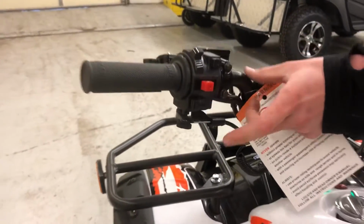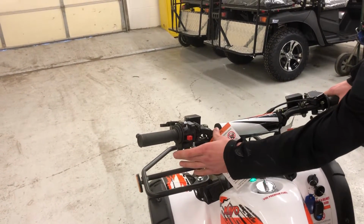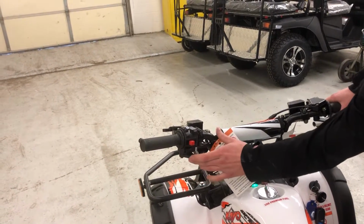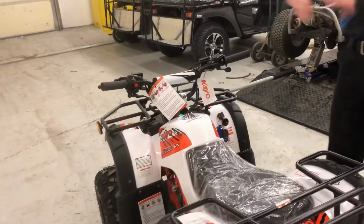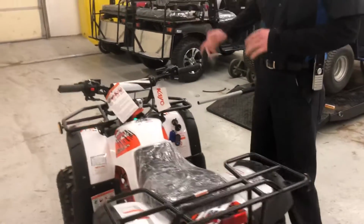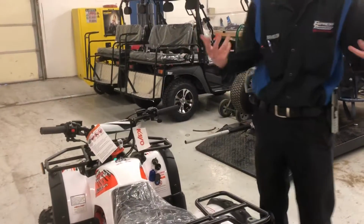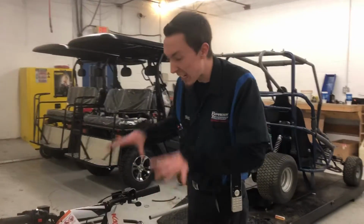So I'm going to go ahead. Okay, so it's actually not going to be choke, and that's just like an old carbureted car. I'm going to give it a little bit of gas, then I'm going to go ahead and move it over to the no choke position. So you see how it died immediately on me? The motor's already warmed up, didn't need choke at all. So that's why I just wanted to give it a little bit of throttle, just like you would in an old carbureted car, you pump the gas. Okay. So that's really it as far as getting it started.